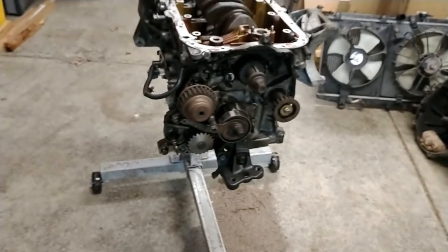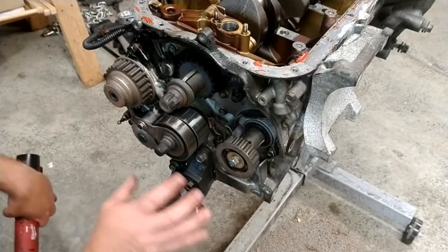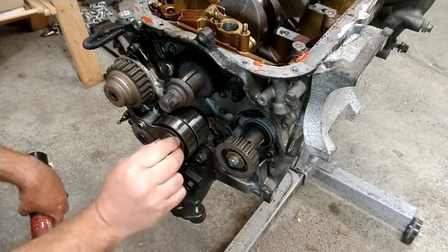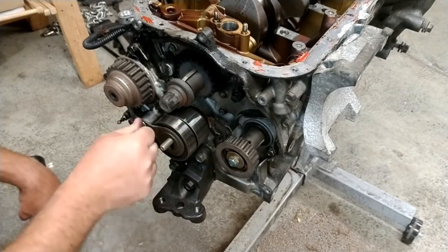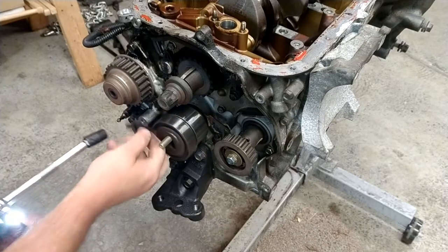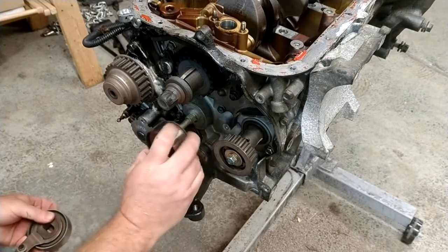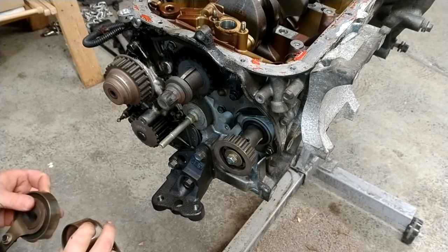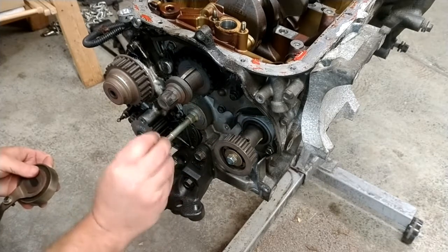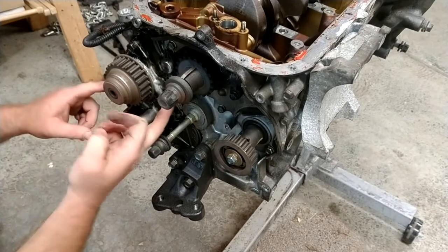What we're going to do is get it mounted up on the stand and I'm going to start taking the front of this off — it's a little more intricate than some I've done before, but I'm sure we'll pull this off. The first thing I'm going to go after is this tensioner here. I've already loosened it when I took the belt off initially, so we're going to take that off. The kit I bought did come with these things new, but I'm still going to try to keep everything the way I found it so that when I go to put everything back on, it won't be too much head scratching.